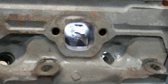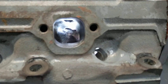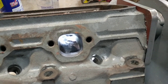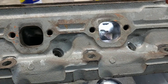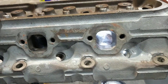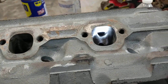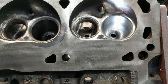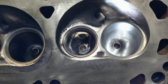The objective is that the engine doesn't have to work hard to suck the air-fuel charge in or push it back out — that's more work available to push the car down the track. Just make it so the air can travel easy, not hitting anything or trying to make any sudden curves. Every time you make the air change direction with sharp turns or ledges, it's going to slow down. You want it to go nice and fast. So that's pretty much it on these.